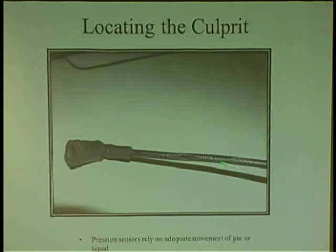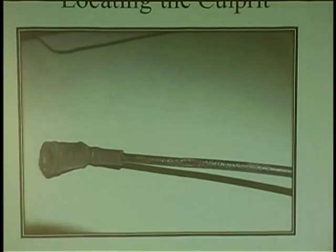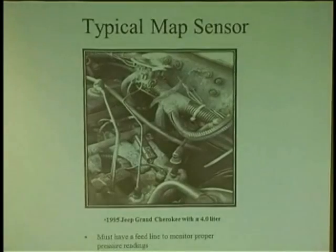You see this? What's that? Let me zoom in a little bit. I've got the zoom action going on here. Melted. That MAP line was right over the intake, and underneath was the exhaust manifold, and the donut was leaking, so all the heat was coming up. It cooked the line to a point where it couldn't move the air volume out quick enough. A simple line, and you couldn't see it. There's no way you could see that because the failure was underneath. So you're looking up top going, you don't know.